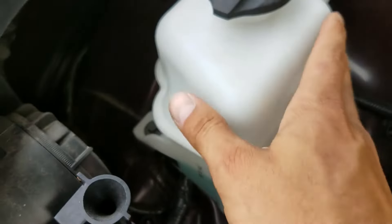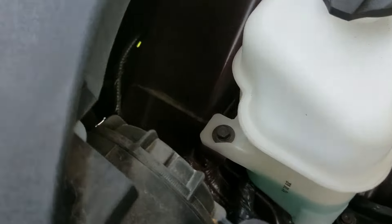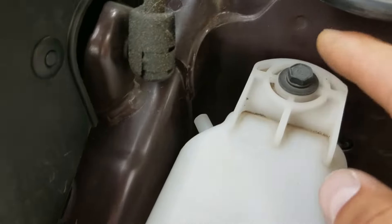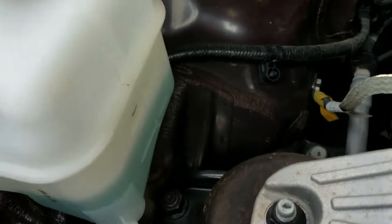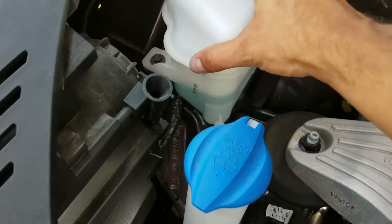This little coolant tank is right here, so it might make it tough on some people. If you want to take it out, it looks like you just take off this one 10-millimeter and this 10-millimeter and just slide it out. You just take two bolts off, pull it out of the way, and set it right here.